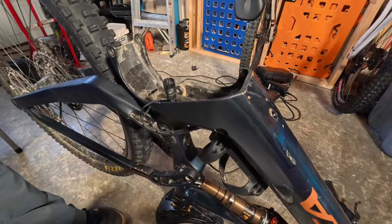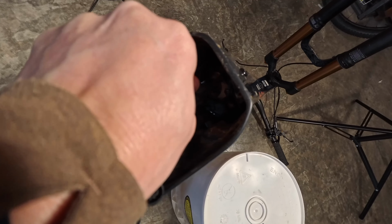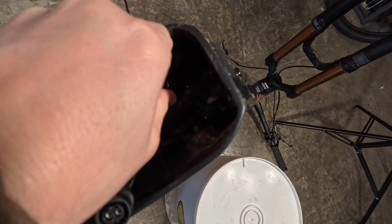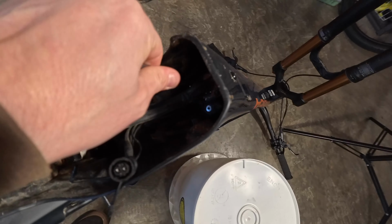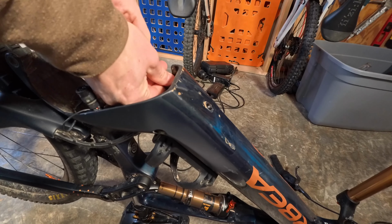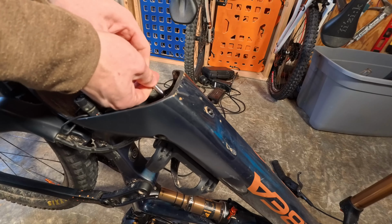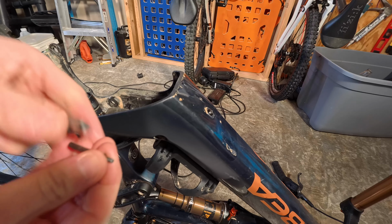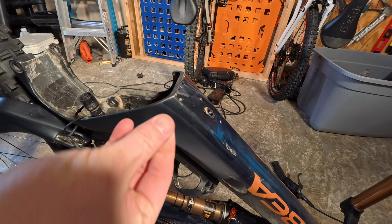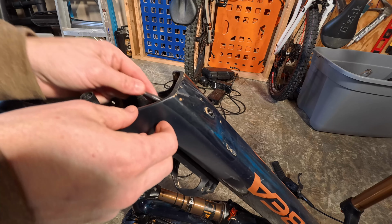Okay, so inside of here it's a 2mm, fairly small. I don't have a T-handle 2mm, so I'm just using this little electronics toolkit that I got. We'll skip to that being out, but removing these is pretty straightforward. I recommend using a magnetic screwdriver if you can so that it doesn't fall off and go down inside of the down tube.